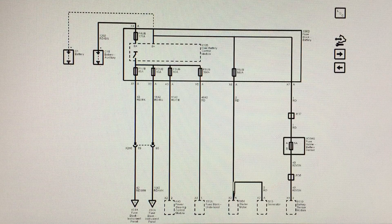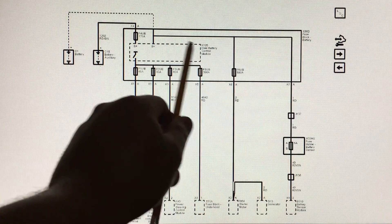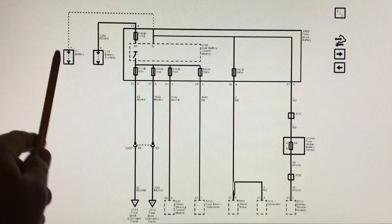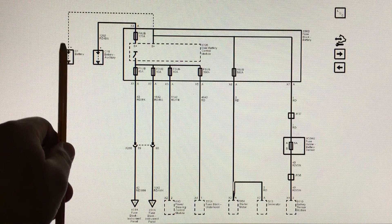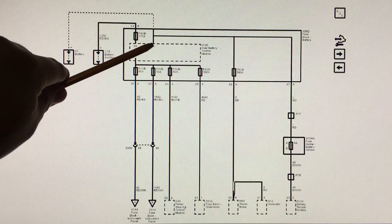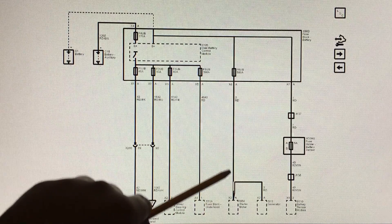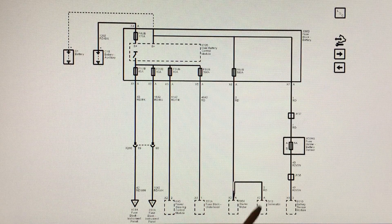Now that we have a better understanding of how the dual battery control module and fuse block assembly is laid out, we can look at the wiring diagram. This dotted line is the dual battery control module, and this larger rectangle is the actual fuse block assembly. Over here is the primary battery and positive battery terminal — they drew a dotted line to represent that battery terminal because it's physically attached to the fuse block assembly. You can see the 500 amp fuse, and then there's the cable that goes down to the starter motor. You'll also notice this same wire gets spliced off and goes over to the generator.